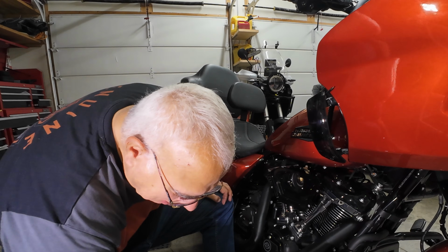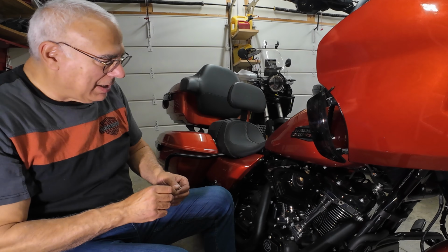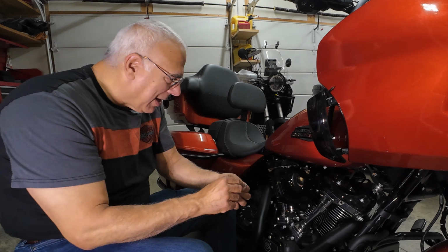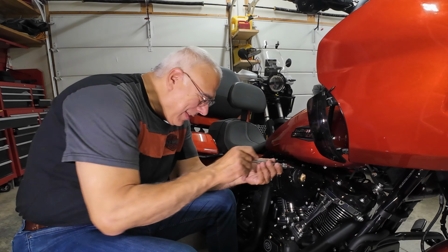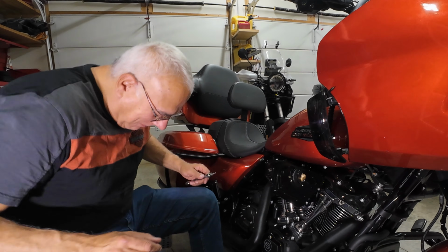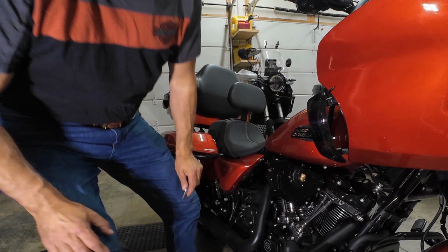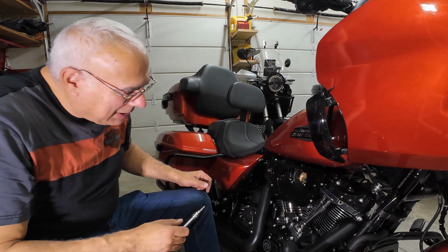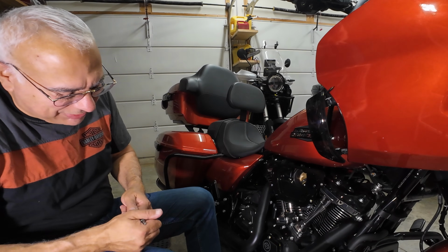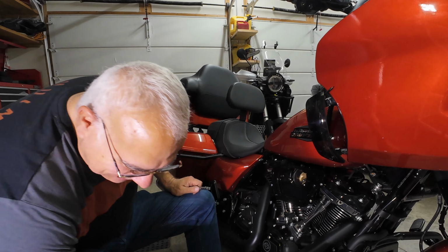Now the top bolt does have some factory Loctite on it, and it's nice it has that cap head that you can grab it and spin it on, hopefully. That's a different, oh man, I think that's funny. I'm jumping back and forth between different Allen drivers on the same mounting bolts. So I'm gonna get these two inside ones. The top bolt is a 3/16, and the bottom bolts are 5/32.